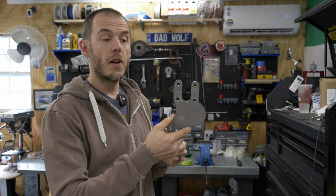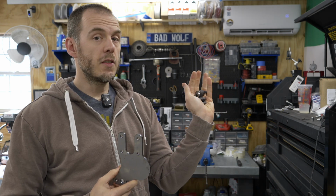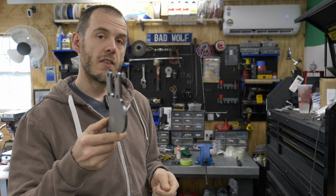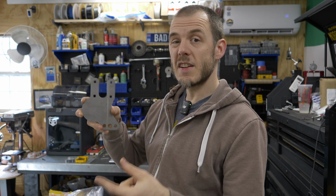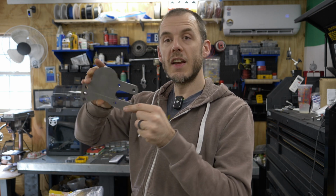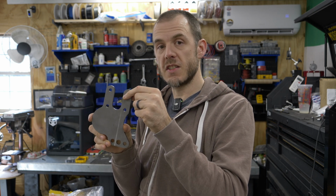This is a do-it-yourself weld-on plate. It comes with 6 spacers to allow you to kind of stand this off of your engine block to make sure everything clears nice and easy. This has also been formulated with the offset on the side here to centralize the weight and the pivot point when you're rotating this engine over on the engine stand.